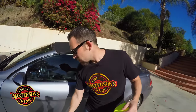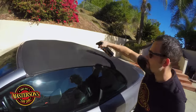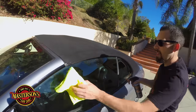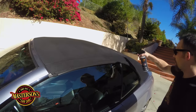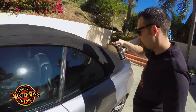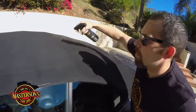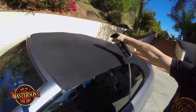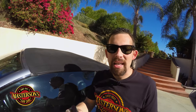I'm going to turn on my sprayer and we're going to spray it all on this top. It's a little windy today, but just give it a light spray — I'm moving the sprayer as I go. I got some on the glass right here, so I'm just going to go ahead and wipe that away quickly. You don't want to let it dry on the surface if you spray it somewhere that's not fabric. This is a very big convertible top — this is no Miata — but I'm just giving a light spray on there. Now I'm going to move to the other side and let this dry for a few minutes, then come back for the second coat.